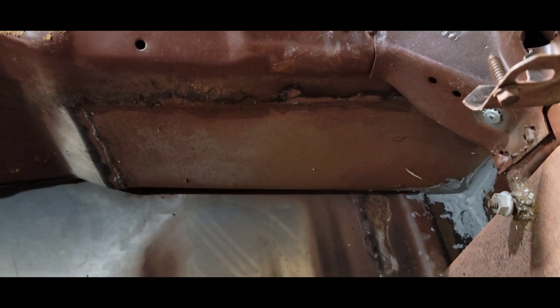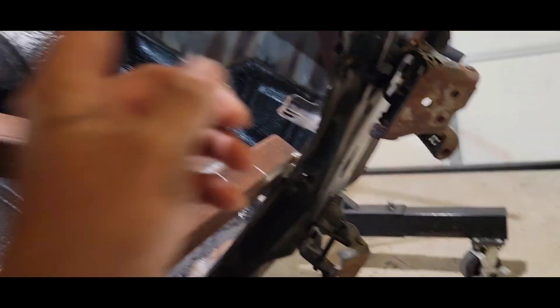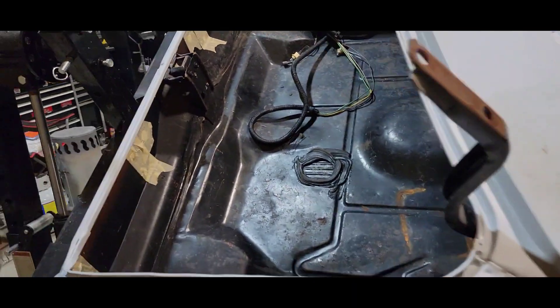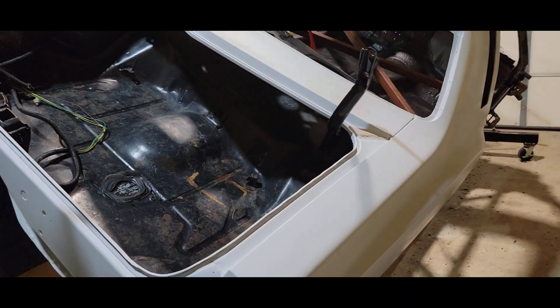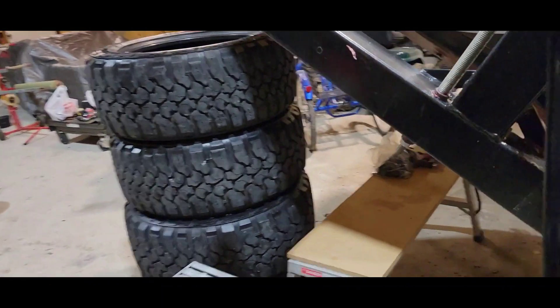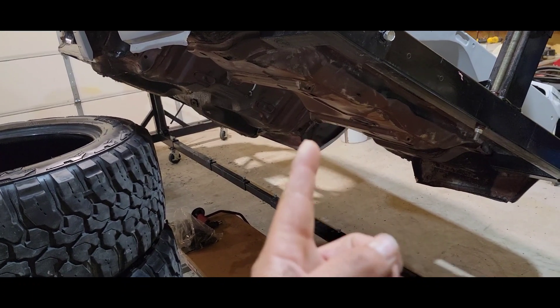Let's see if you can see underneath there — that's the section that I cut out, welded, made my own plate, and welded that in there. That'll get all undercoated and cleaned once I get this section ready. I power washed it out pretty good — it had a lot of rat droppings and nesting material in there, so I took all that crap out. So the body is now ready for me to start cleaning and prepping, getting the belly shot with undercoating.